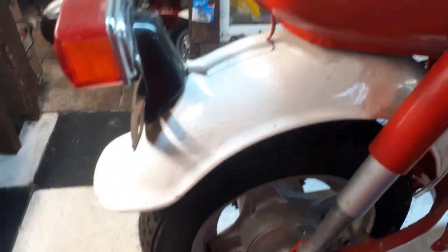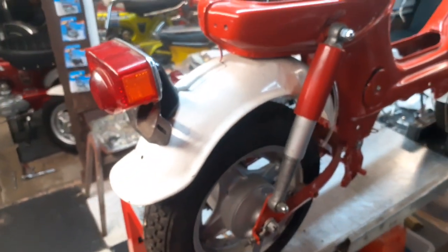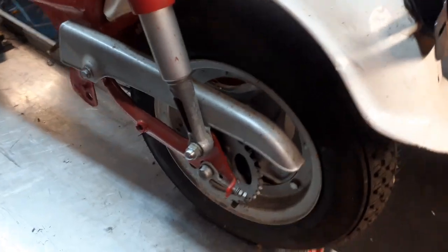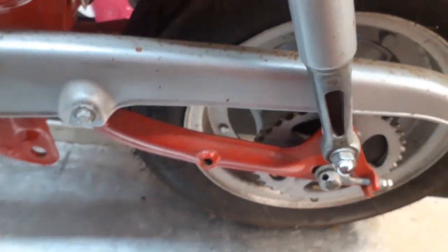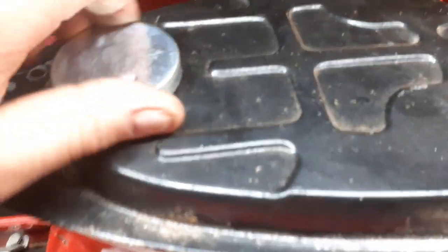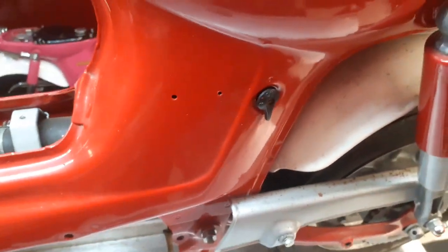I've already had the rims done for the pink one, so it's just a matter of getting the hubs done. The back mudguard looks original to me - it's got that little kick on it and the hump there. It's got a little battery box, the loom's been uncut, it's got the back light - even though I think it's the export one with a reflector on it. The axles I can utilize for the pink one, get them all zinc plated. The chain guard I'll keep as well - nothing gets thrown away or damaged.